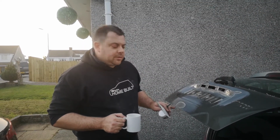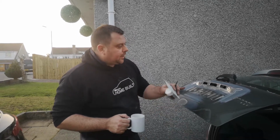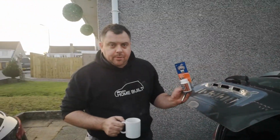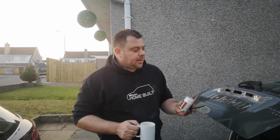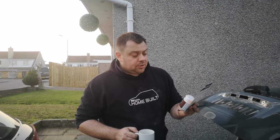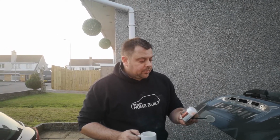Now we've got everything sanded down, we've got rid of the rust on all the sections below the back window on the tailgate. What we're going to do is use a rust inhibitor to stop any further rust coming back. We use Hammerite Kurust, it's the best one I've used so far. It's available at any motor factors, and we'll also leave a link for it in the description.